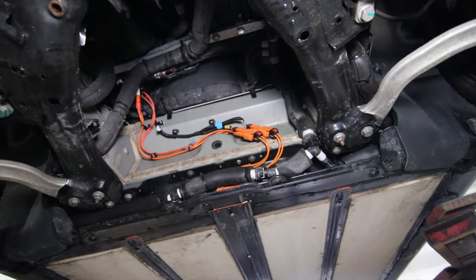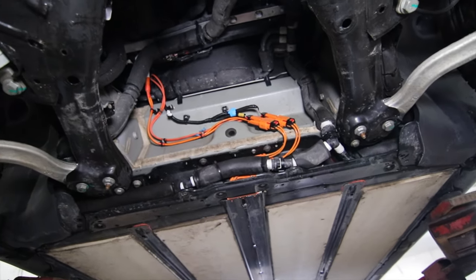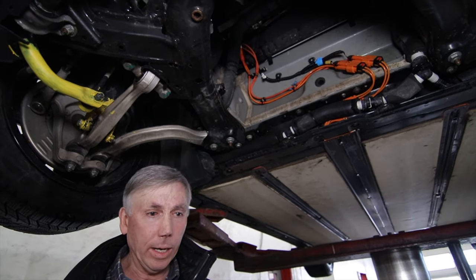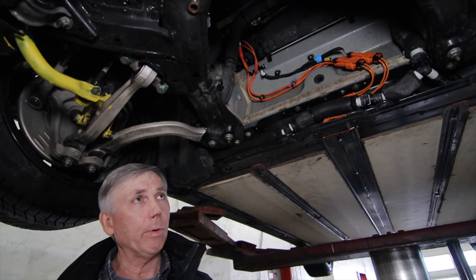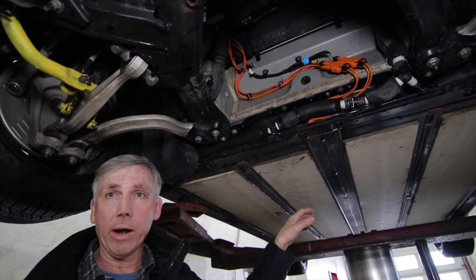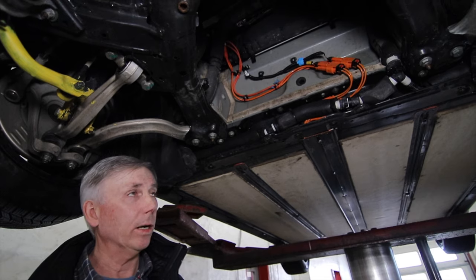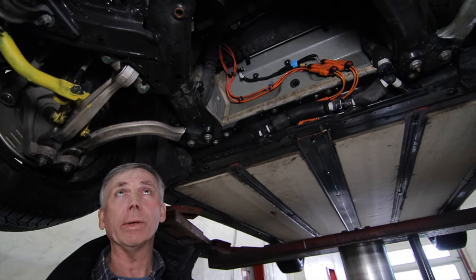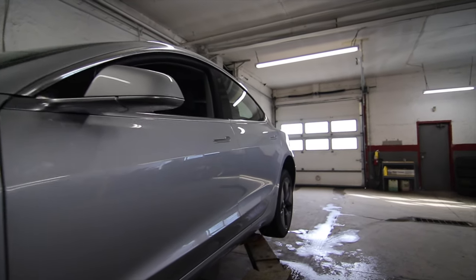And that's another reason why the pipe insulation is important, because after you park, the car is designed so that even 2 to 3 hours after you park the car, there's still about 5 liters per minute of fluid being driven through all these pipes and through the battery. So it's actually actively cooling itself even when it's parked. Really? Which is very counterproductive for us Canadians or anybody that lives in a cold climate. And that's even in winter climate conditions? Yep. It'll be running. That's right.